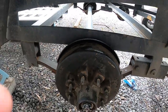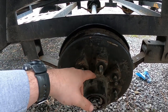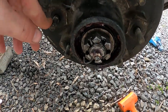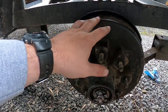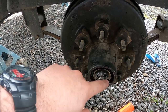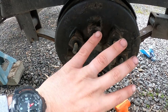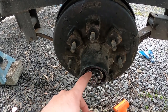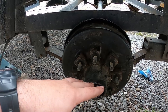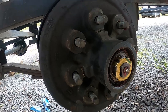Put the camera down while we were putting the hubs on since it got a little greasy. Take your hub and drum and put some grease inside. With the easy-lube axles I don't put a whole terrible amount because I'll lubricate through the easy-lube port. Put your hub on, slide your bearing in, put your washer on the end, then put your nut on. Snug it down first to push the grease in and seat everything, then back the nut off about a quarter turn. Put your cotter pin back in and this side's done. The other axle doesn't have a cotter pin — it has a gold locking piece on the end of the nut — but the same process applies.